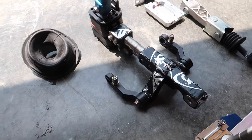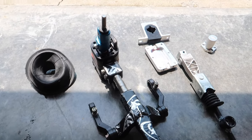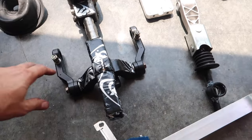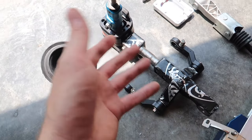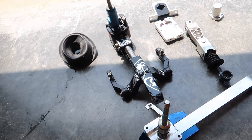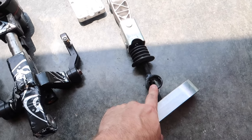I've been ripping the Steeda Triax out of the car — went in very easy but had a little tough time getting it out. I've got the MGW and the Steeda side by side. The MGW is the race shifter, the X-Spec trim in its lowest height — the short handle is about a 25% reduction. The Steeda Triax is 30% reduction. Going over the differences: the MGW has its bridge and legs — everything is transmission-mounted to the MT82. They don't use any stock components — everything is basically assembled ready to drop in. The Steeda does reuse some OEM parts, like the pivot cup.